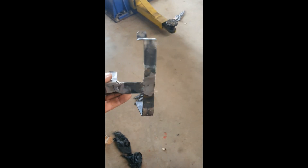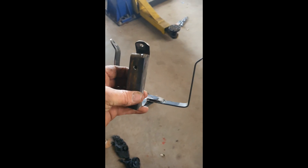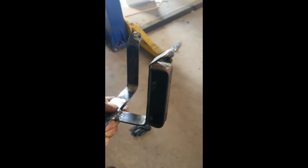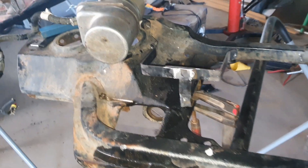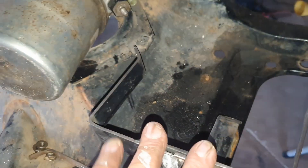I've bent it up - just bent three pieces, set it on there, tacked it together and welded it together. To fit it to the rad support I've used a bit of angle iron. I should have flared the ends around so it looks neater, but I'd much prefer to just have a couple of drill holes in that rad support rather than weld something to it. So let's put it on there and see what it looks like.